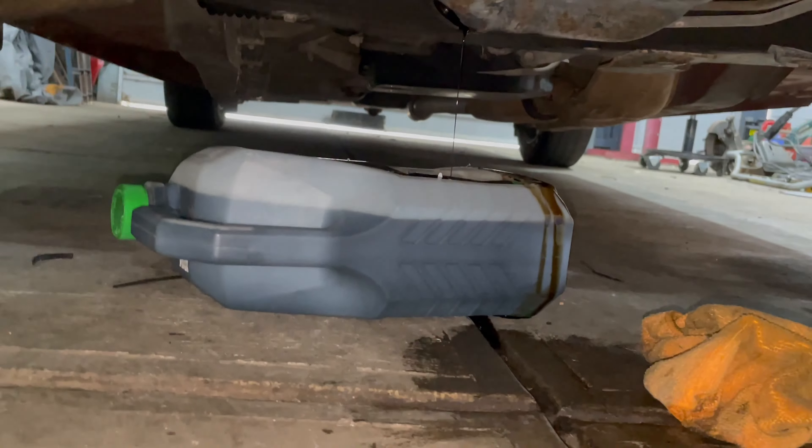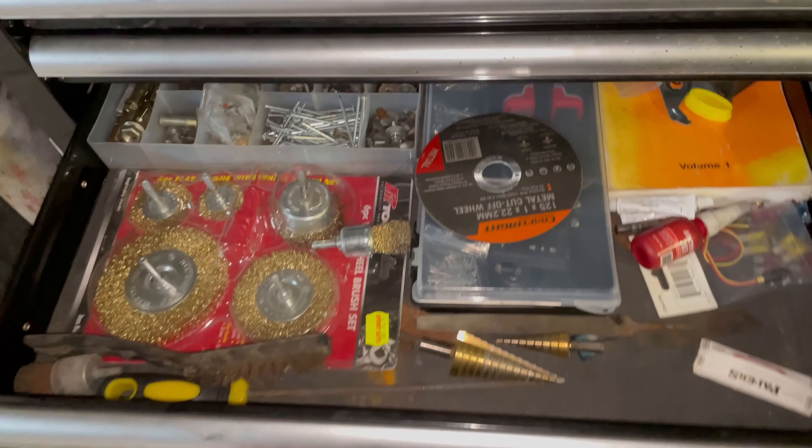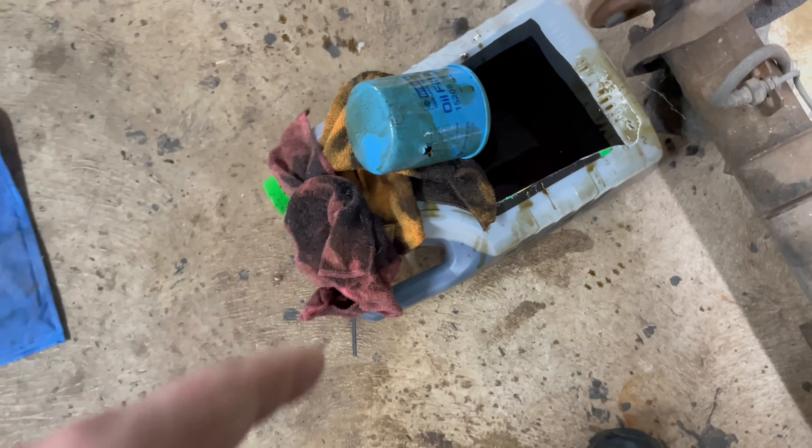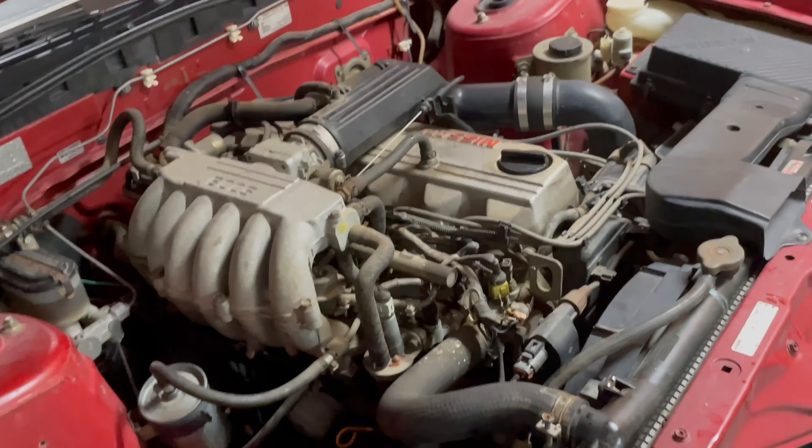It's slowing down a little bit and it's not completely full, so yeah, about four and a half litres I reckon. Old filter's out — I had to do the good old screwdriver and hammer trick because it was too tight. You just hammer a screwdriver straight through it and then use that for leverage to pop the oil filter off. New one on — there's obviously no oil in it now, but I'll do that at the end.